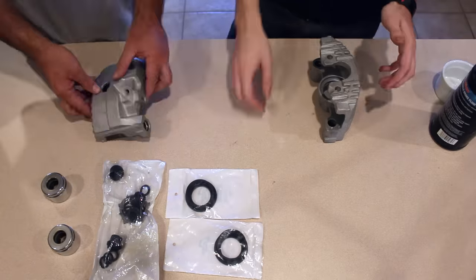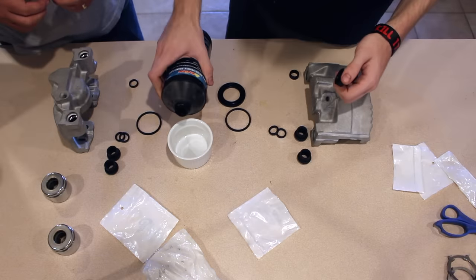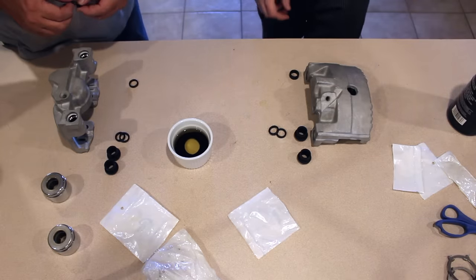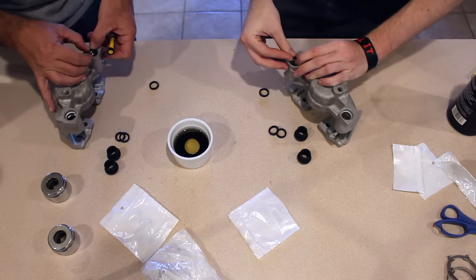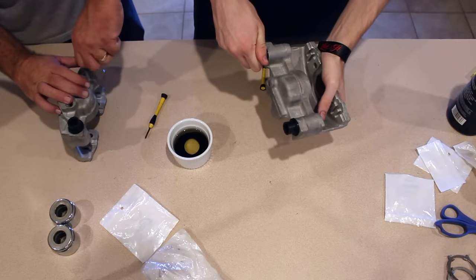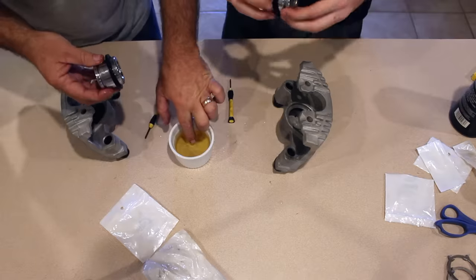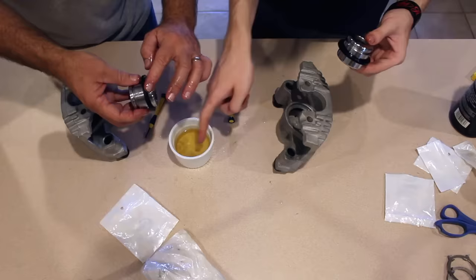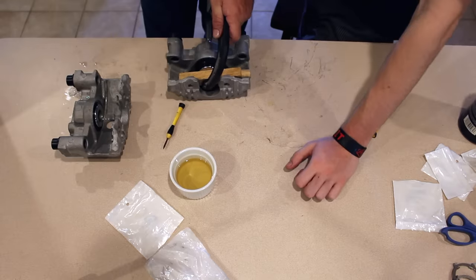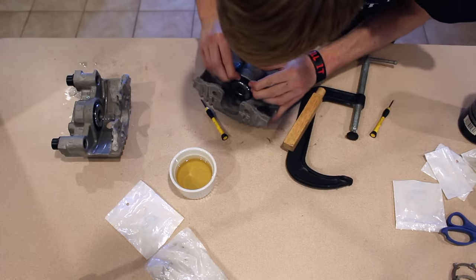This may be a little confusing to watch, since my dad and I aren't going at the exact same pace rebuilding these at the same time, but hopefully it's still easy enough to follow along. The first thing we did was put all of the seals for the piston inside a little container of brake fluid, just to make sure there's plenty of lubrication when they're installed. While they're soaking, we installed the O-rings and boots for the slide pins — they are a little finicky, so a tiny screwdriver was used to help set them in place. Once they're all in, the square cut seal is added inside the cylinder. The dust seal is then fitted around the piston, both the piston and cylinder are given a good coating of brake fluid, and then the piston is pushed in. It's a really tight fit, so a C-clamp had to be used to press the piston in all the way. The dust seals were then pushed down onto the recession in the caliper, and that's both front ones fully completed.